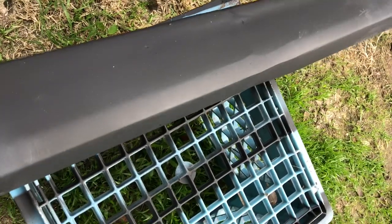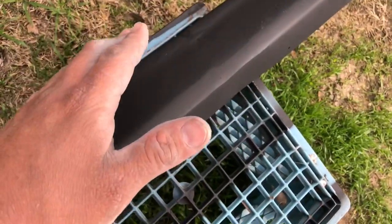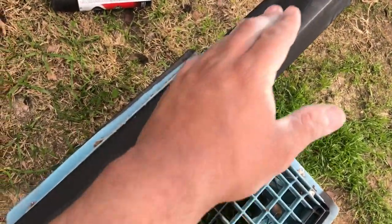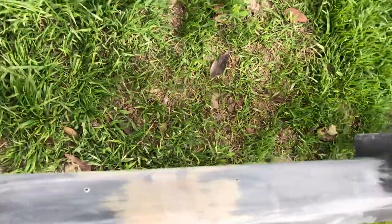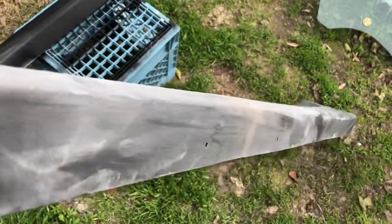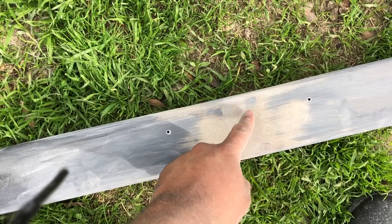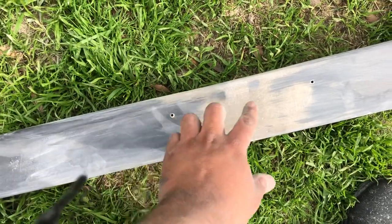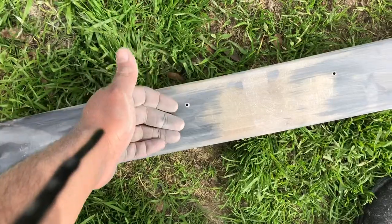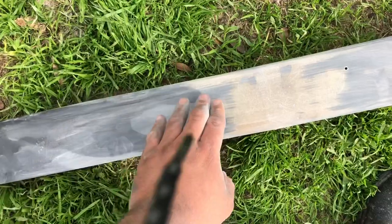I went ahead and already painted the area that I already molded. Now we want to sand this with a big sanding block so we can get a really perfect straight surface - not wavy or curvy. I already went ahead and sanded one side skirt. You can see it's pretty good. We can see this is a low spot and this is a low spot - we're going to go back in with some Bondo and clear it up. But first, I forgot to cover these holes - I'm going to go back and fiberglass them from the back, then put Bondo over it. You don't want to put Bondo over a hole like this.